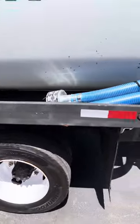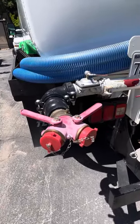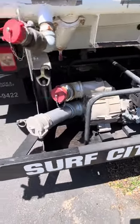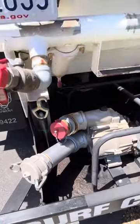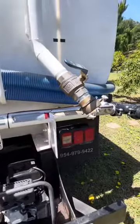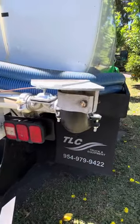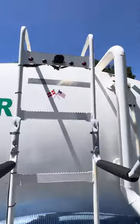There's a 2.5-inch and a couple of 1.5-inch ports as well, all air actuated. On the back, we have a 300-gpm trash pump with 3-inch connections that have been reduced down to 2.5 to fit the hard suction lines and standard fire department connections to be able to fill the water tank. It comes with the hard suction lines. There is one rear road spraying nozzle left in the back. It has a backup camera.